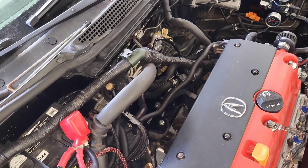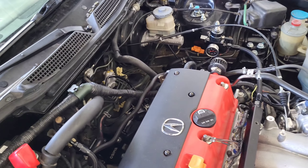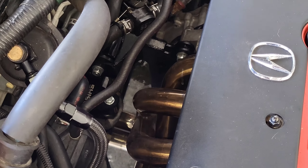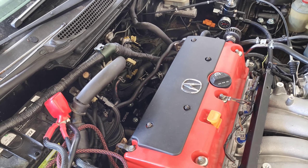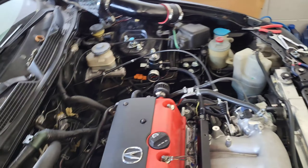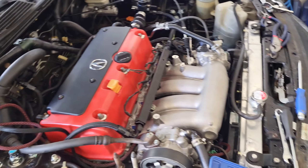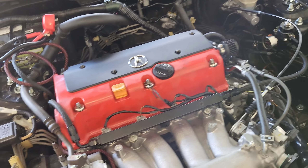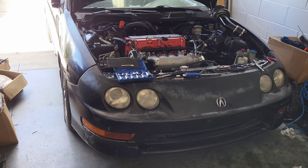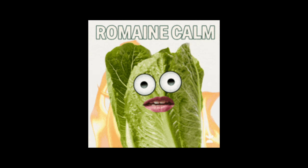I went ahead and ordered an aftermarket rack and pinion — that's going to be an all-day job in the scorching sun. You can see it's leaking down there and the reservoir has dropped a lot, so we can't have that. I'll change it out, fill it up, and bleed it. It's an old car and the maintenance was really neglected — a lot of stuff was shot. But we're getting it up to par. The Integra is going to see a big change everybody — stay tuned. Thanks for watching, don't forget to like, comment, subscribe, and stay tuned for more budget Integra content.